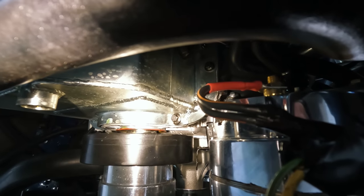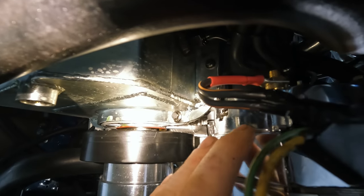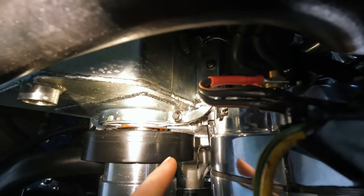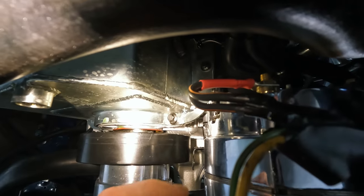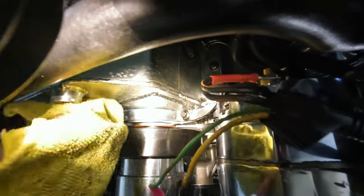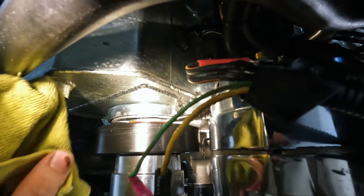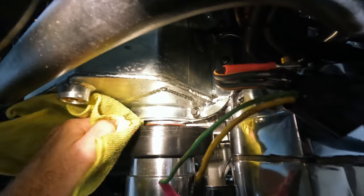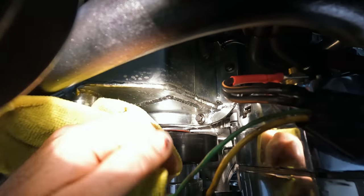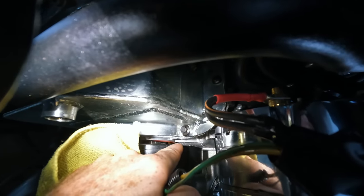In terms of diagnostics, of course, you can put a pressure test on the system. You could do lots of things, but always getting stuff up to temp, or to the point where you know the issue is happening, is going to help you chase down leaks a lot more. Now, with everything being polished and shiny on this car, it really makes it hard for investigation. The nice thing is that coolant leaves these water spots, and I can see where it was dripping from the back of the water pump onto the timing cover there.